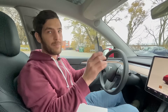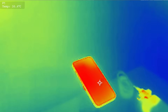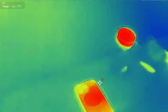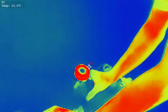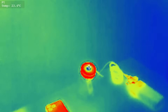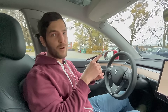I've actually done my own kind of controlled experiment at home, where I had my phone cooled down to ambient temperature. I put my phone on the charger for 20 minutes in airplane mode — I wanted to make sure there's nothing backing up or any background tasks. And after 20 minutes with the active cooling switched off, the back of the phone reached about 34–35 degrees Celsius. Then I switched on the active cooling element — there's a switch that says turbo — and after the same 20-minute ambient-temperature charging period, the back of the phone was actually just about 32–33 degrees Celsius. So cooler charging. But then I noticed that I had actually gained more charge in turbo mode versus standard mode.